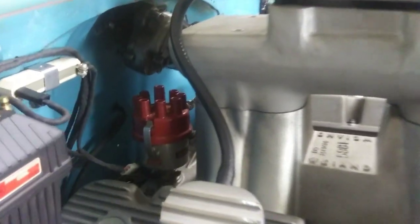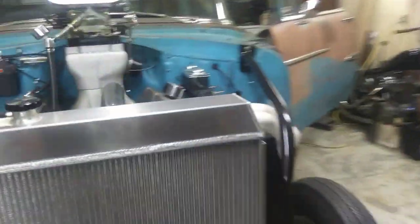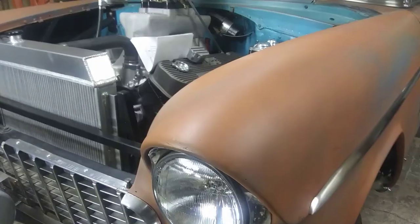I need to get my wires on here for the motor. I need to set the timing again because I moved the motor over and my distributor wasn't tight. We'll set that at eight degrees top dead center, roll over, get that air to burst out of the top of center, then crank her up. Before that I'm gonna start running the front wire. I'm going to do the headlight bucket ones first - take the headlights out, get the pigtails coming out, get the marker lights pigtailed up.